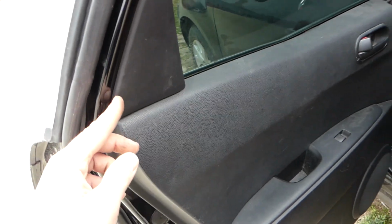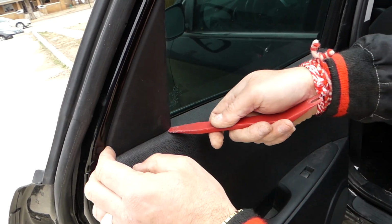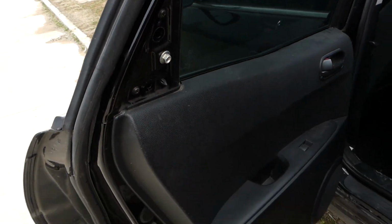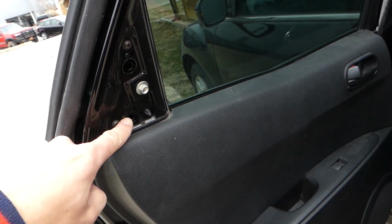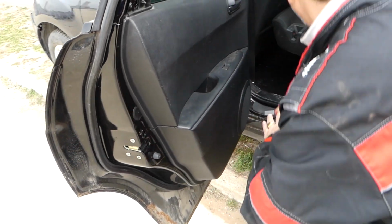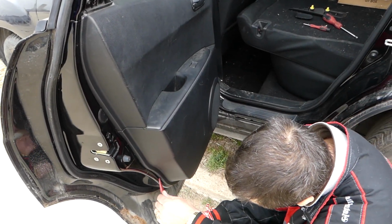Now this cap right here guys, let's remove that one as well with a plastic panel remover too. All the parts and tools that we use will be listed in the description of the video below. Yes, two clips, they go in these holes right here. Now with a plastic panel remover too guys, we're going to start popping the clips open.